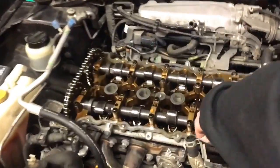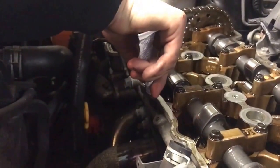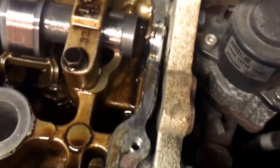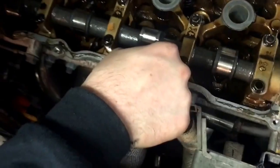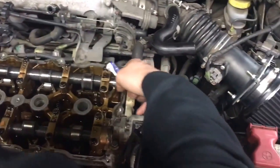So what are we doing here? You put the RTV on the corners of the cam area - the big joining surfaces. Get it in all the corners that need it, especially those big sealing surfaces. Don't put RTV on every cam lobe - that was a joke. You want to get it on the mating surfaces and the corners. Try not to dump it all in your valve cover area - only some is good. It's probably not ideal but it might help quiet it down a little, especially for those long drives.